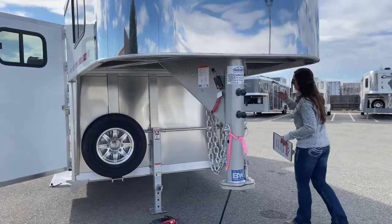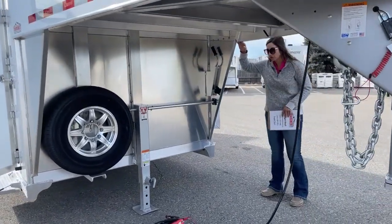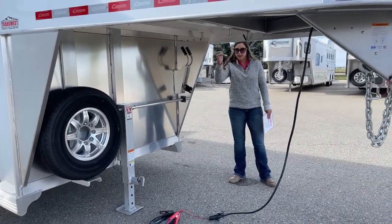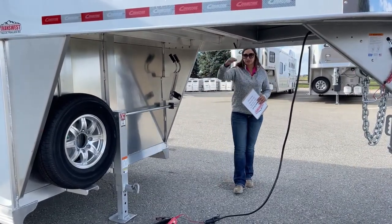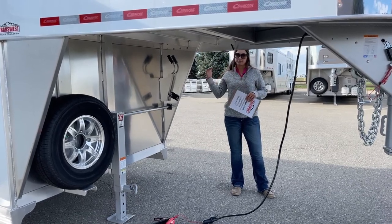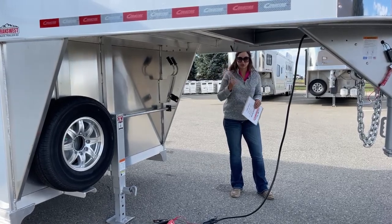What we also did — we have been ordering inventory trailers with a 53-inch Gooseneck drop, so that's from here down to the floor. That extra drop is going to give you some extra space between the truck bed and the trailer, give you some extra play-in room, so you're not having to ride super uphill in order to get enough clearance between the truck and the trailer.